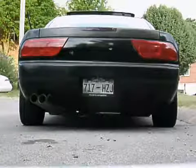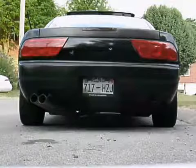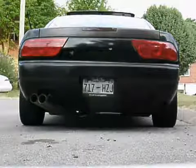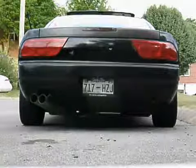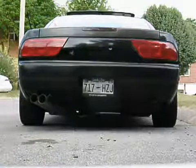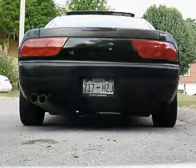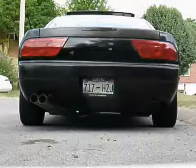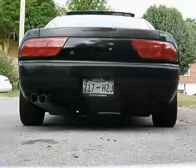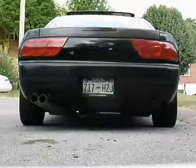So this is it on my car. Stock motor, stock manifold, stock CAT — stock everything drive-wise except for this catback. It fits really well. The tips tuck up in the back really close to the tow hook. I'm also using the Circuit Sports little blue poly exhaust bushing, so that keeps it held up pretty much as high as possible.